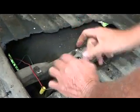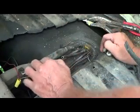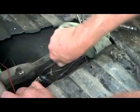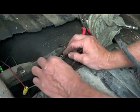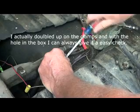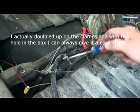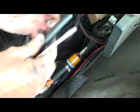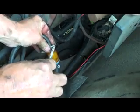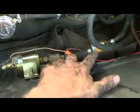I'm at the gas tank using a tube cutter because I don't want to use a hacksaw — no sparks. There it is; shine it up a little bit. That's what I'm going to hook my gas line up to. These other ones I need to cap, except for the one that goes up to the reserve — that takes the gas vapors, so you have to study all that. I'm going from the gas tank into the fuel filter. I left some extra room so I could blow through the line and see if it's clogged, trying to make everything so simple the dumbest mechanic in the world could fix it.